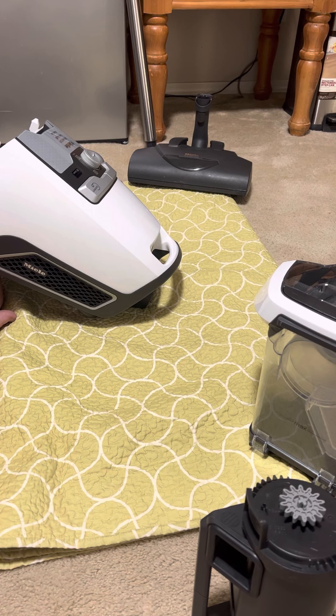The reason you might need to replace the gore filter is that if you have pets, pet dander from dogs or cats has an oily substance on it. When you wash this with cold water, it's water-resistant so it stays in the filter and never fully comes out — it might still smell like wet dog after cleaning. Also, after you've washed the filter so many times, it starts to break down the fiber. Minerals in water get caught in the filter material and clog it over time. At some point you'll have reduced suction or it'll smell bad, and cleaning just isn't cutting it anymore — that's when to replace it.